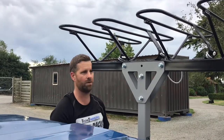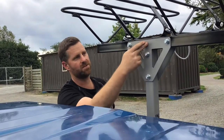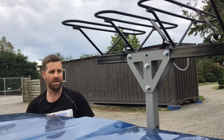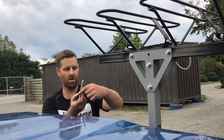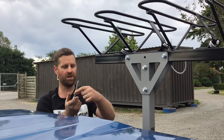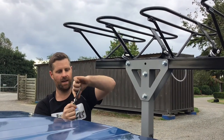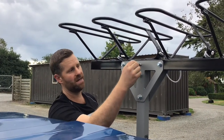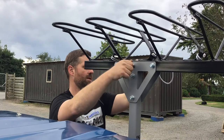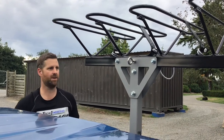That's on. The final thing needed is a 10mm eye bolt provided with the rack. It goes through the centre and can be used to hook a support strap to. When you get the eye bolt it'll have two washers and a nut. Take the nut off and fit it in the right position with one washer on the vehicle side, then a washer and lock nut on the back side. We'll do that up at the end. Our top bar is now on.